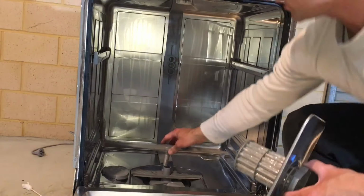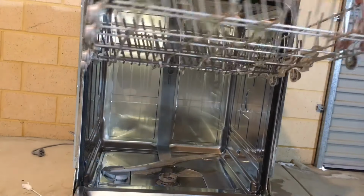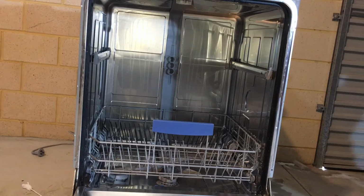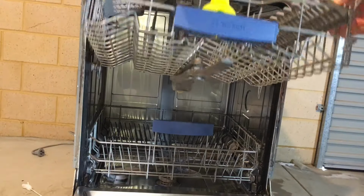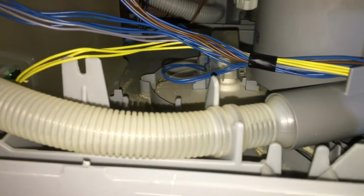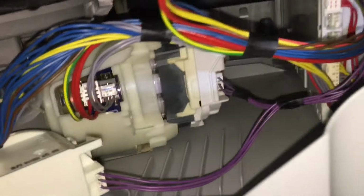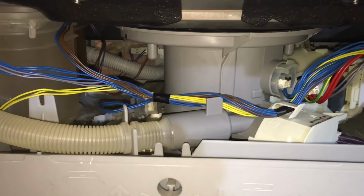Next, you want to refit the spray arm, refit the filter, put all the baskets back in place. Before you reassemble the dishwasher, have a look under, make sure there's no water in the base here, make sure there's nothing that's wet inside it here, and before you put all the covers back on, plug the dishwasher in, run it without this plate in place, and look for leaks,